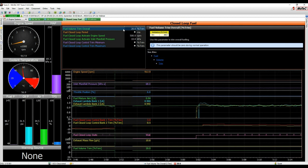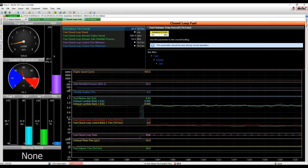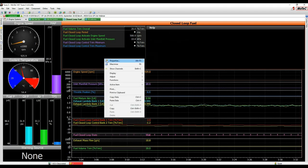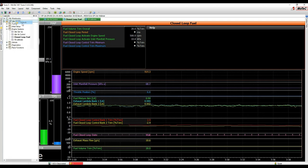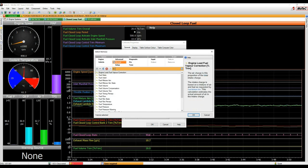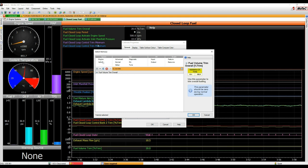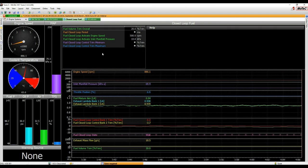All right, and maybe your particular setup hasn't got the fuel overall trim parameter on here. Not all our worksheets had that. It's something I added. I'll show you quickly how to do that. If you go to layouts, right click, it's already unlocked, so you would unlock it there, come in here, right click, properties, unlock, properties, and then add, and we would type fuel overall trim. Okay, untick normal, and there's our fuel overall trim parameter. It's already there. We double click it, go okay, it'll turn up on your closed loop screen.